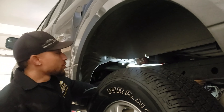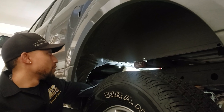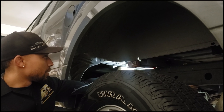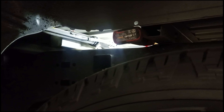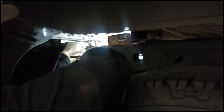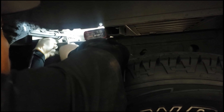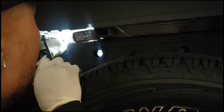Part of the install for the fuel pump upgrade, you have to get back here behind the driver's side rear tire. There's a hose clamp that holds the filler neck tube — it's a seven millimeter. I usually use a quarter drive ratchet, an extension, and a seven millimeter swivel. You can usually get in here; the clamp is somewhere in this vicinity, so you can loosen it up.